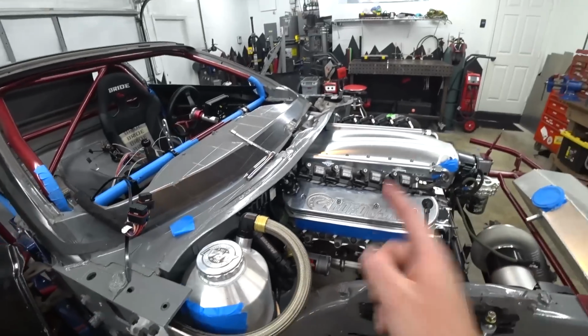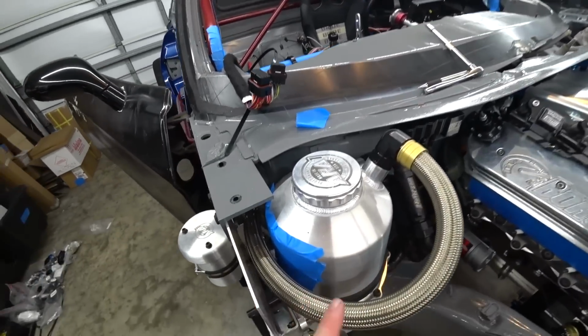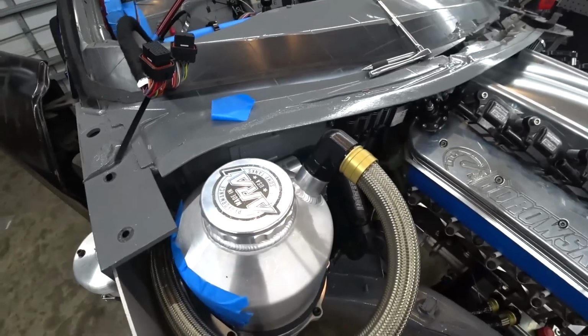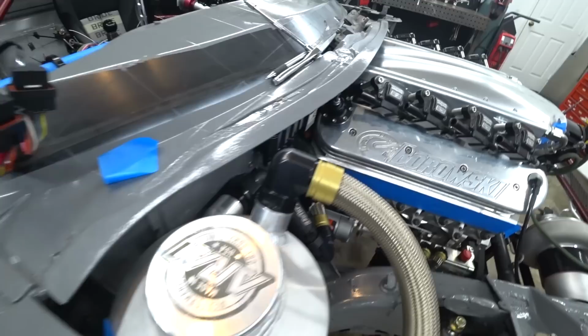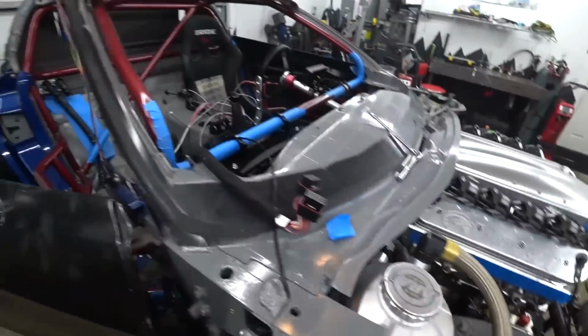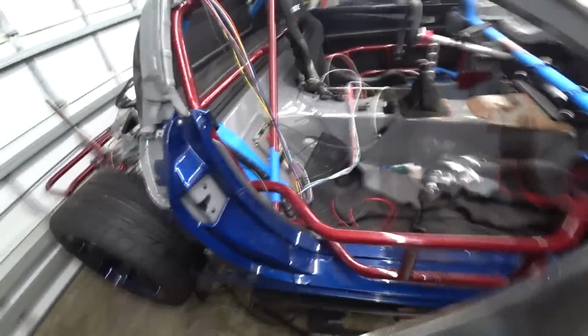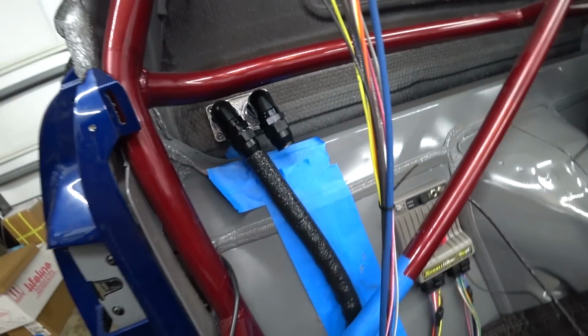Boom. So not only did we get that done, but we actually got some more line stuff done. So Josue got this line in, down to the breather tank for the dry sump tank. That panned out really nice with those dual ORB 90s because we need some room down here left. We're gonna run some ventilation. So that line's done. We got one of the coolant lines done for inside. So coming through there, boom. And up to there, we've got it heat sleeved to be up to the rules of clutch kickers and FD.